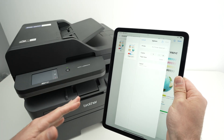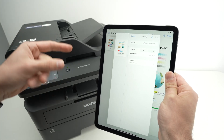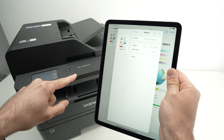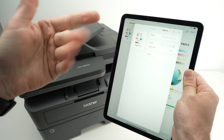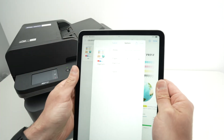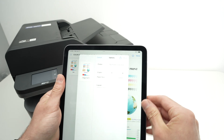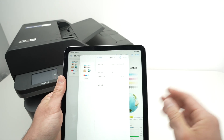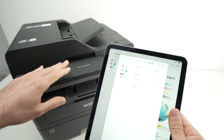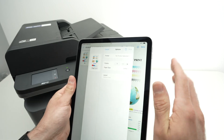The first thing you need to check is that your printer is connected to the same Wi-Fi network as your iPad — both need to be on the same Wi-Fi. If you have multiple Wi-Fi networks in your house, like a 5GHz and another one, your iPad may be on one and the printer on the other, which is why you're not seeing it.